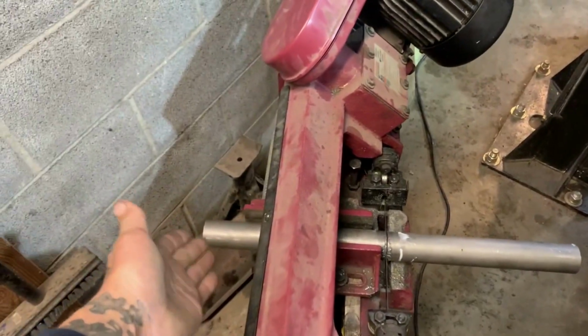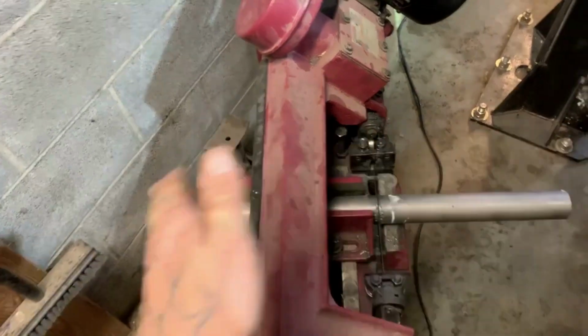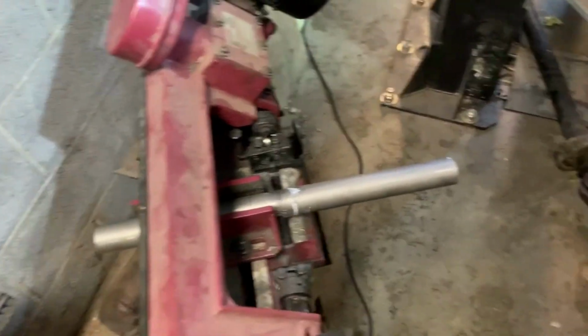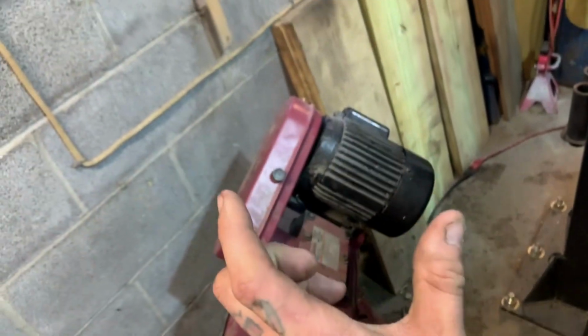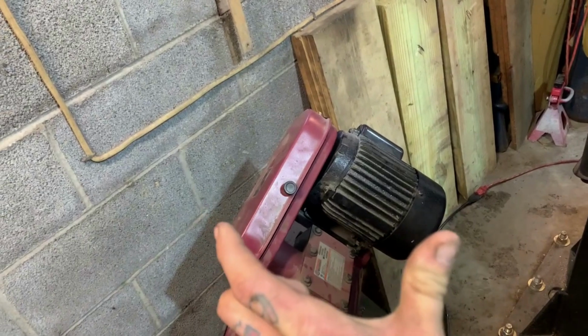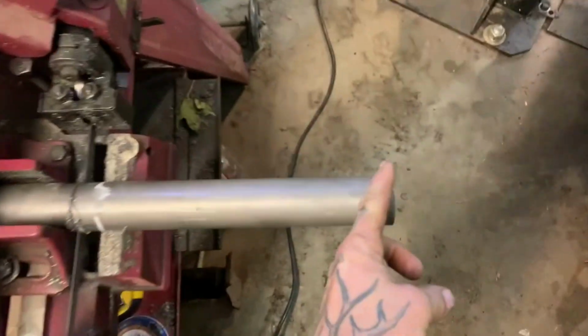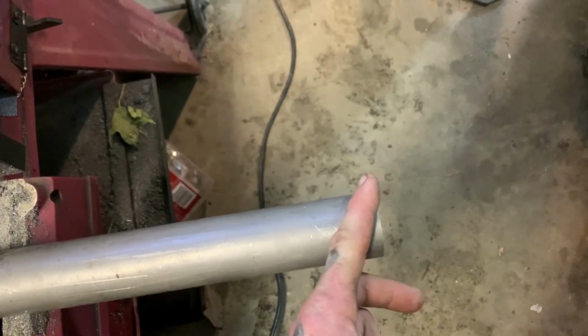I'm going to need one for the other side about the same. So we cut it at 10.5. It gives me plenty of room on both sides to get the angles and everything worked out. And I got 5 inches of pipe I'm going to need in the middle from short end to short end. So I'm going to go ahead and cut 7 out because I shouldn't need too much of an angle to butt these two things together. It's probably going to be about like that.